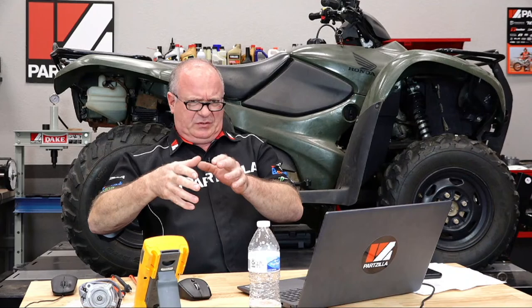All right, Joe is asking me, hello, sir, thanks for your videos. I have an 07 CBR 600RR front brake rotor. Is it true the round bobbins are supposed to flex or rotate or remain stationary? I believe it's a floating rotor. Okay, are you talking about the rivets that are actually holding the disc on? Those shouldn't rotate. Those should be very, very fixed, because there should be no play or wandering in the rotor itself. So my answer would be no. So I may need to replace that one.